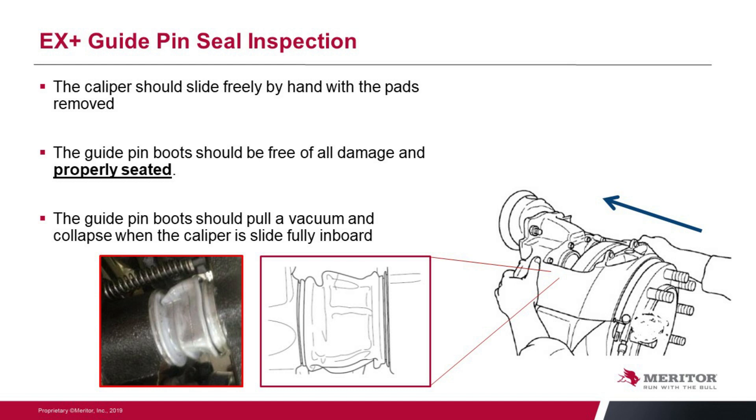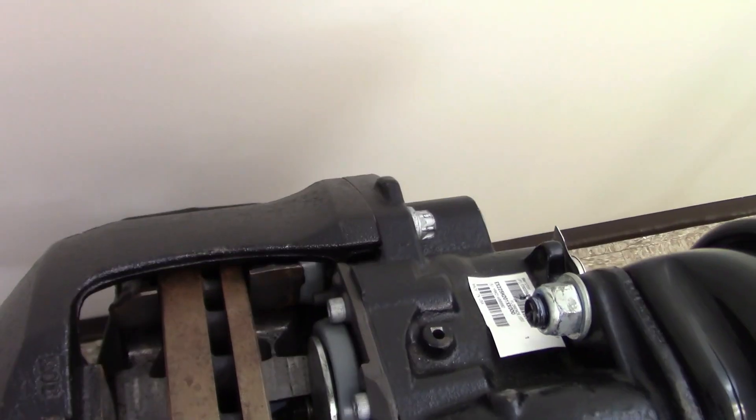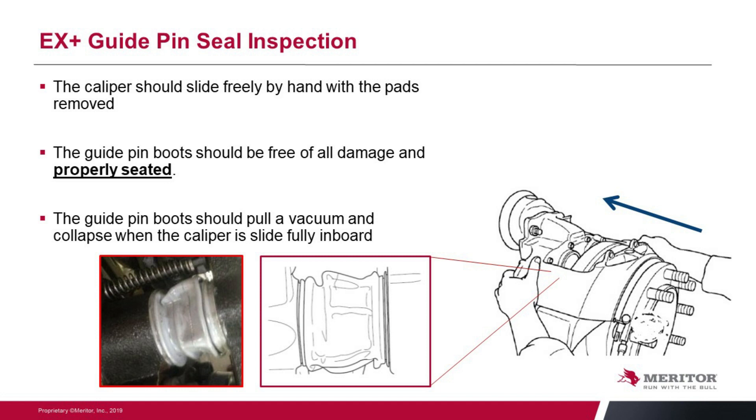Once you've done that repair, those boots aren't easy to install. They're very thin, flexible, silicone type rubber that need to go into their mounting grooves and be put on correctly — and there's a chance you might actually tear them. So you can do a very easy check: if you take that unit and fully go inboard, pull it back, that boot will cause a vacuum and suck down right onto the pin. Just sit there and count to 10 and watch — if it doesn't come back up, you've done a really good job installing that boot. The video shows it: you can see that boot collapsed, pulled down onto the pin. Do that count to 10 — it didn't expand back up. Perfect. There are no tears or pin holes in that boot and it's properly seated on its mounts.